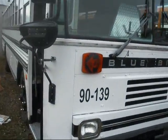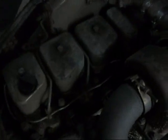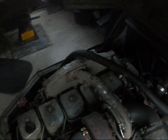The other bad news is this TC has some engine issues now. Nothing really major, but if you look on the side of the block here, you can see stuff kind of running down the side there. It must have popped a head gasket because it's starting to seep coolant out the side there. You can see some stuff coming from the block, or the back bolt there. It's not really a huge deal on these — you just have to pull the head off and put new head bolts in. So that will be another video when I get around to that. It's not something I've ever done before, but we'll get on it. That's the bad news.